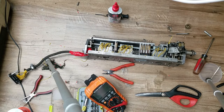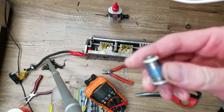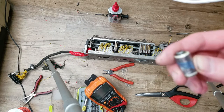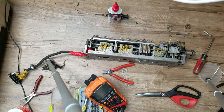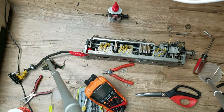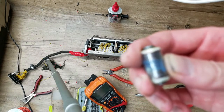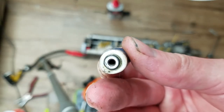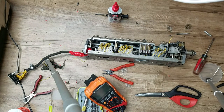The piece I was trying to solder to just fell out because it was disconnected there. The problem is I'm not sure what sort of enamel they use on this wire - normally you can tin fine magnet wire just by running it through a blob of solder on the iron; it just burns the lacquer off and tins it. But this doesn't do that - it just burns and gets crusty but doesn't actually tin. I found you can burn it until it gets crispy, then scratch it off and get shiny copper. However, that's not going to be possible here - I think this is going to be a write-off on this coil, at least.